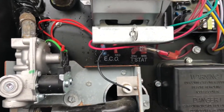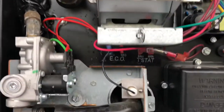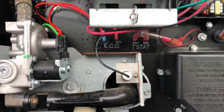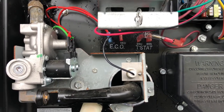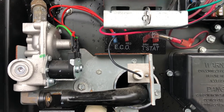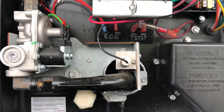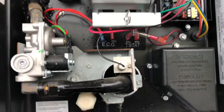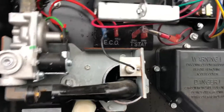On this specific unit, the thermal cutoff is what ended up being bad, and this has been a pretty common occurrence with these new style Dometic water heaters. You'll want to buy a couple — I'll post a link below in the video where you guys can buy them either from me or from another online competitor. It's completely up to you; when you buy it from me it supports my business and helps me make more of these videos.